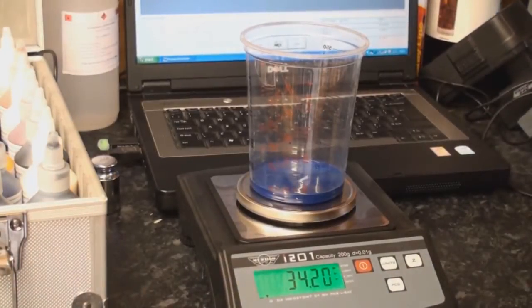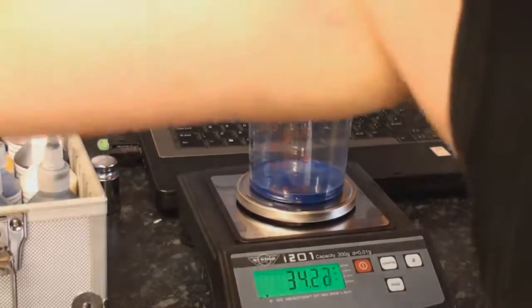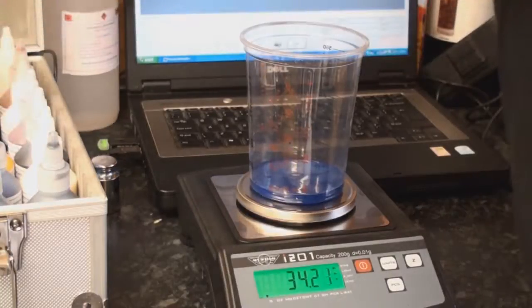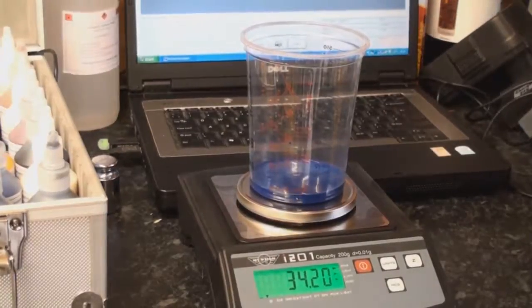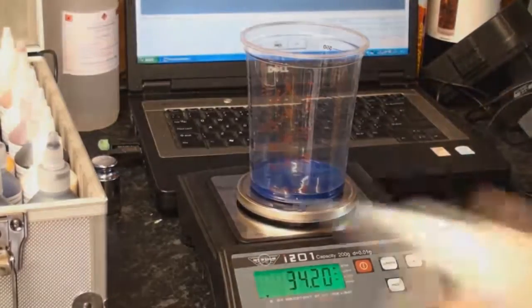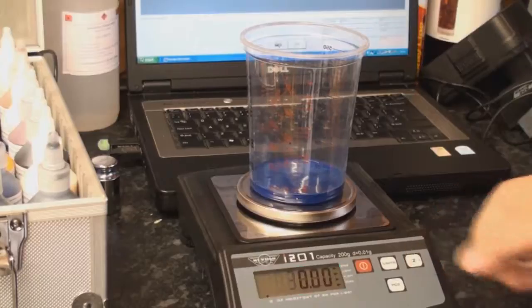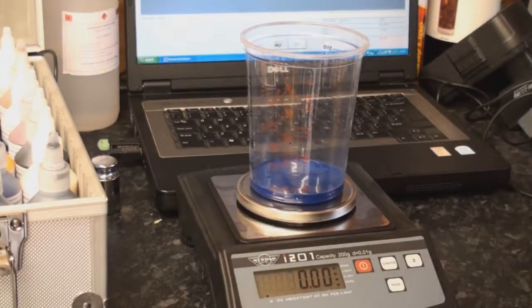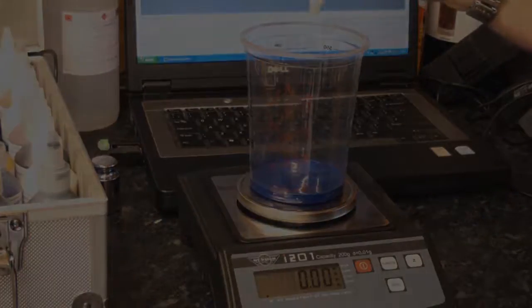And we're now looking for paint number PLT779. Which I've got here. I'll give that a shake, because it will settle. And I'm going to zero that again. And now I'm looking at putting in 13 grams of this one. So again, 13 grams I'm looking for now.